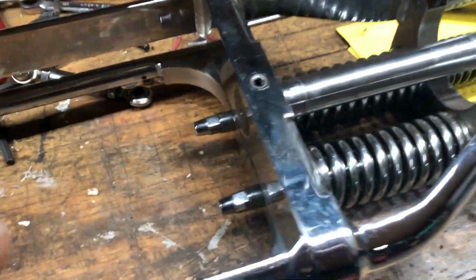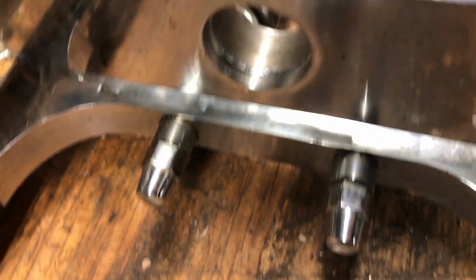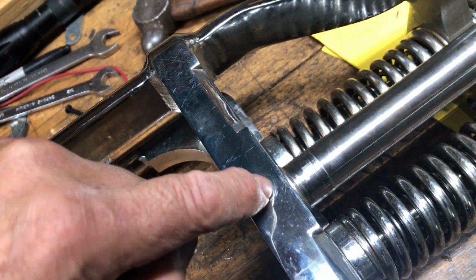Okay, that only took a few minutes. Just a couple little zaps with the drill, and you can see there, I'm just about flush. Well, it is pretty flush. There's the camera right down there. Just buzzed her in a little bit more, not very much. But now you can see here, there's a pointer. Right here I've got a little edge now, so that'll keep this off the bottom of the frame. So next thing I'm going to do is just grind that off on that same 45 angle. It's probably going to catch a little bit of that hole there.